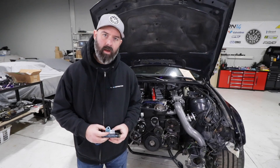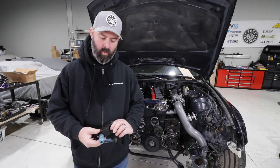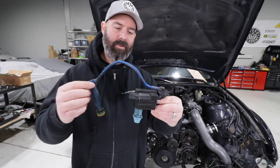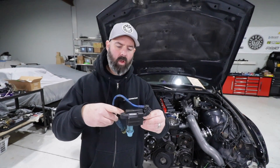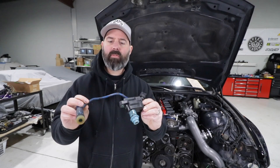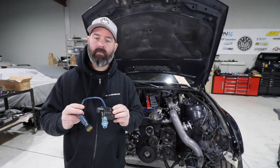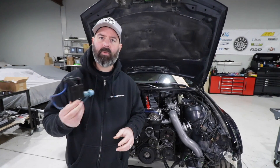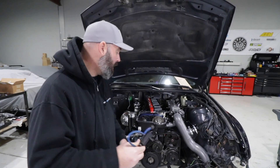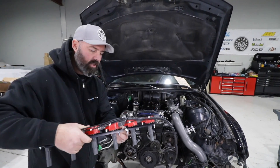Our first job today is to install our new ignition system. In case you're wondering why we're not reusing the factory ignition system — the 20 year old system — it's like one coil pack per two cylinders, which works fine, but when you start to push it really hard at higher horsepower we've certainly seen reports of guys having ignition breakup issues. So we are going to upgrade because we are going to push this engine hard, and we are upgrading to Ignition Projects' complete ignition system.